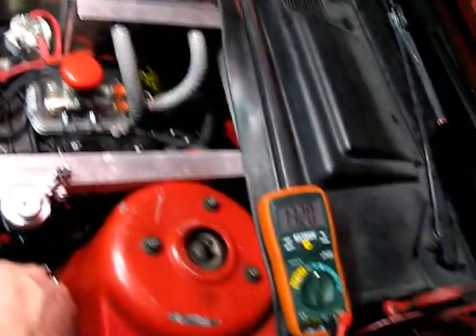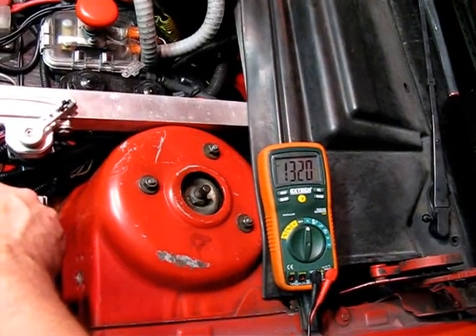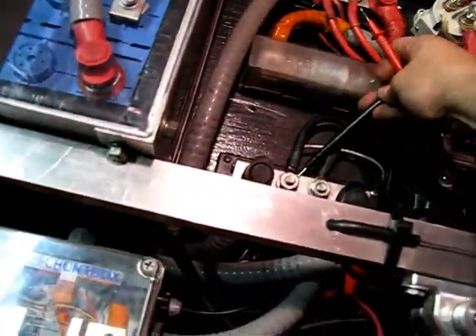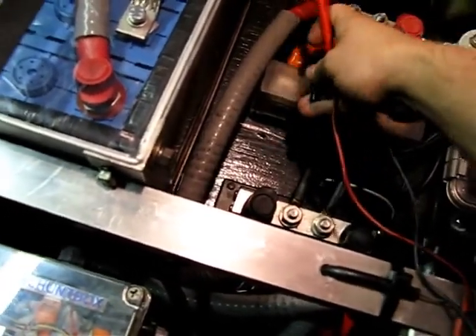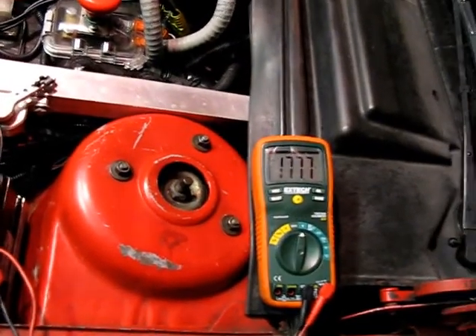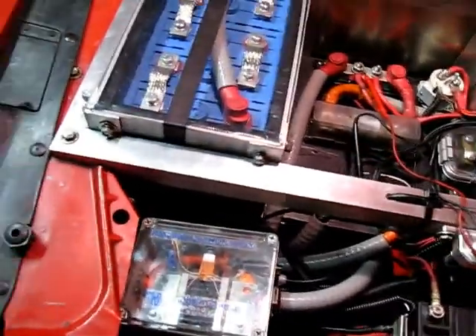You can see that it's just killing the voltage — we're actually getting a check gauge light, which means it's below 11 volts. We're in the garage, and that's like kind of a maximum strain on that thing, but it's still a little scary that it can't quite keep up. Without the blower fan, just the power steering pump, it's holding better — that motor fan just really kills it. For reference, as far as what voltage we're running at in the main pack: we're at 177.7 volts currently.